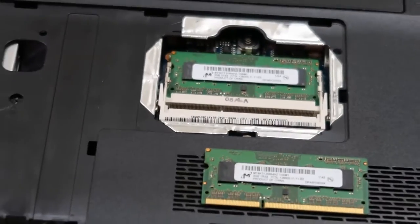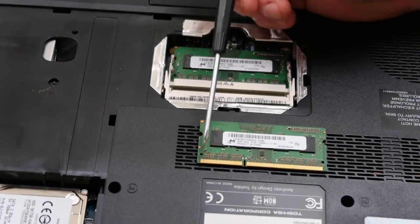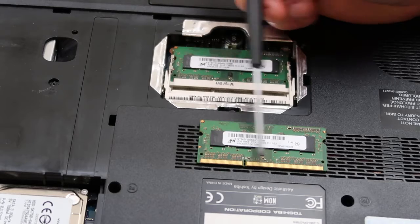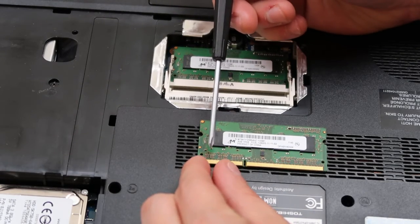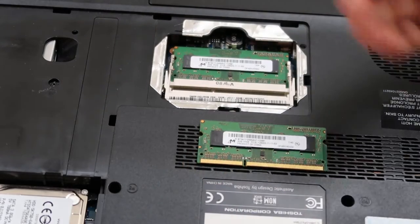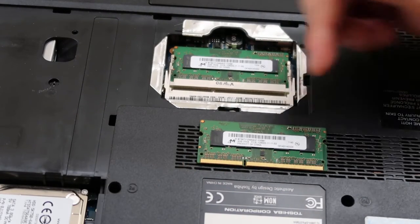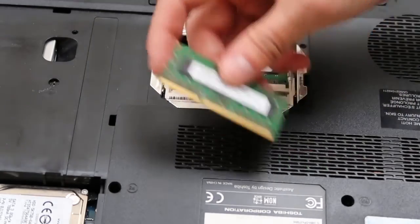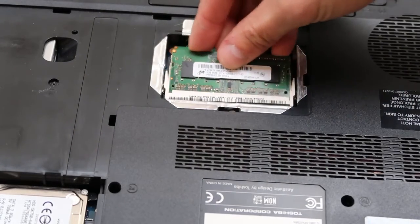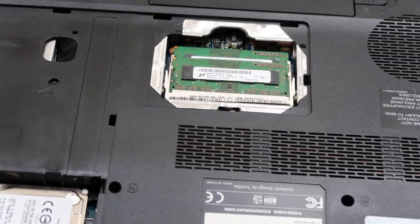So that's how you would buy the correct RAM. You can tell DDR3 because it's got this many pins on this side and this many pins on that side. With a DDR2 stick, one side will be a lot smaller — that's how you identify a DDR2 RAM. So you can tell by looking at them what they are, but if you don't know, you would use those two numbers to order the RAM. And then to put the RAM back in, you just plug it in, get it nice and flush, press down, and there you go.